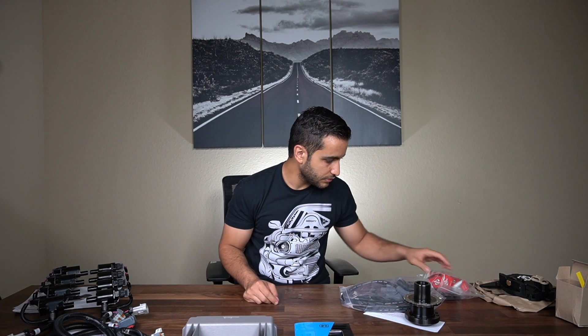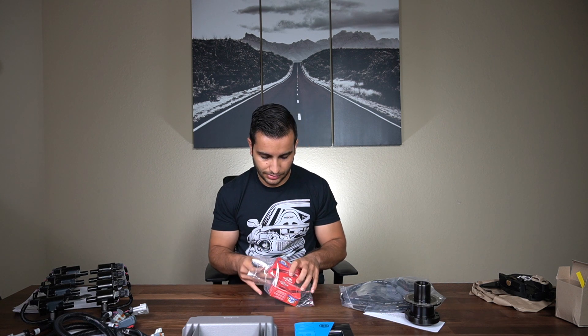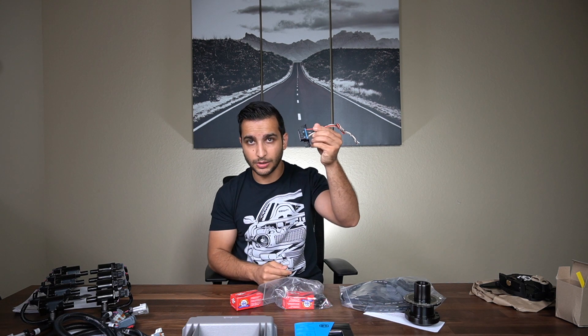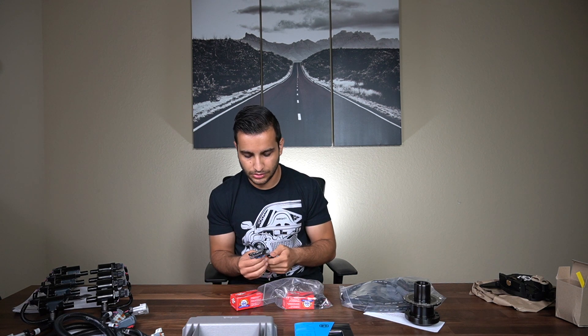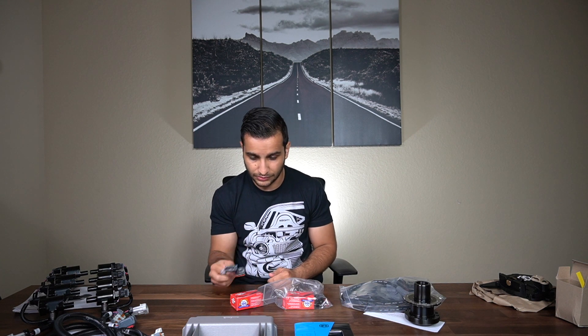Another piece I wanted to cover: on my LT1 I don't currently have OBD2, and this kit itself also has the option to include an OBD2 port. That's very helpful when you want to tune the car and understand diagnostics. OBD2 is just the technology to have — OBD1 is old school and very inconvenient. From an overall perspective, pairing the new ECU with the HP Tuner and the ability to have OBD2 — you can't go wrong with that.